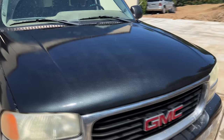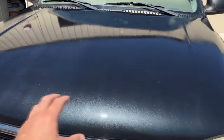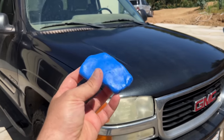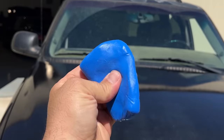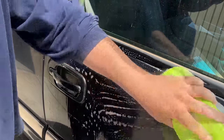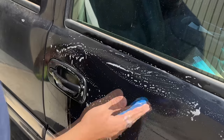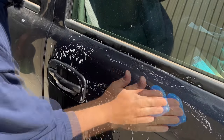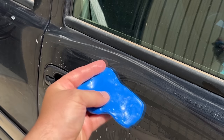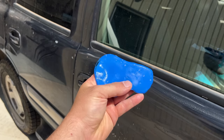There's another step before wet sanding that you'll need to do if you're wet sanding or polishing an older panel where the clear coat wasn't just freshly sprayed — and that is using a clay bar to pull out the dirt and gunk that has etched itself into the clear coat. The clay bar is quite sticky. You get some water or detailing spray on the panel, make the clay bar wet as well, and then simply go over the panel. This pulls the dirt and gunk out of the clear coat so when you go to polish or wet sand, you're not spreading that around.